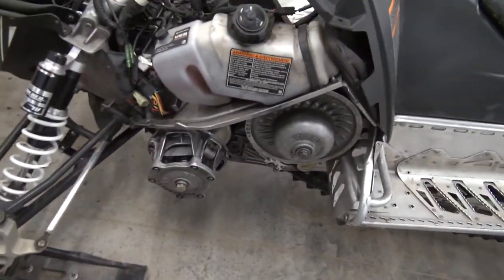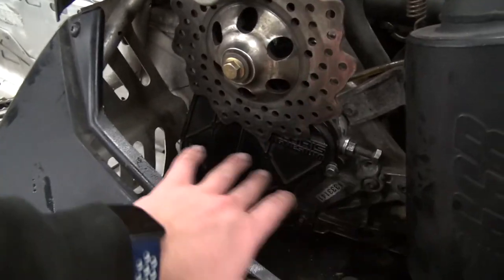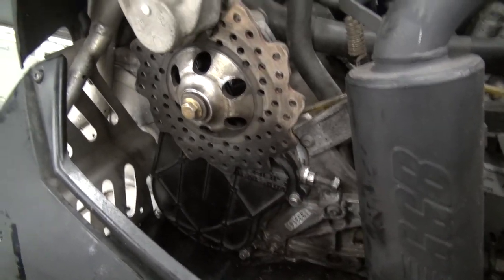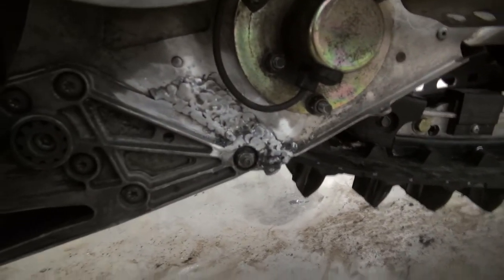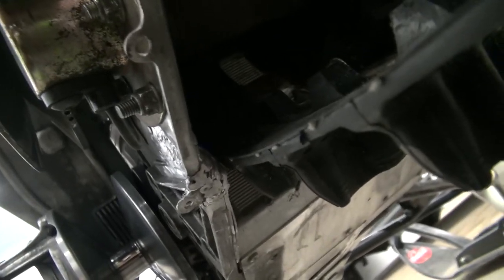Shout out to my dad for helping get the track on - definitely needs to be tensioned. We got the track on, we got our primary and secondary clutch - primary was already there, secondary got put on. We have got all of our chain case, all the gears back on, filled with oil, tightened the lock nut finger tight, quarter turn out, tightened the nut and then put all this stuff back on. Coolant looks a hair low so we're going to have to add some of that. The weld looks really good and there is just enough room between the track.